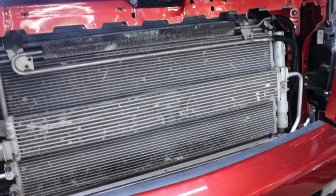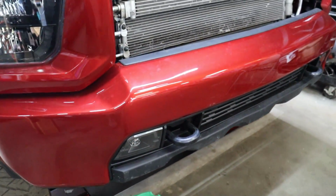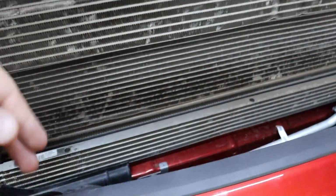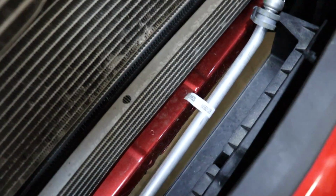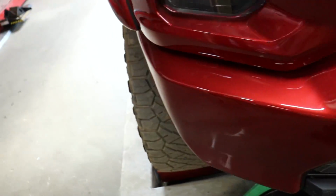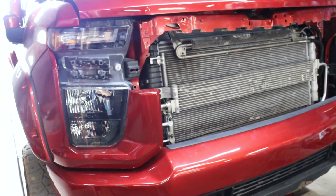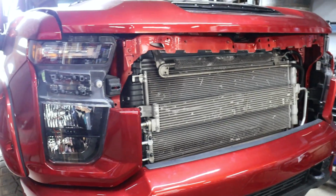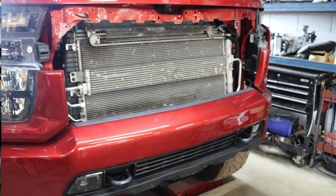Lots of pieces, let's go ahead and tear it down again, get the old one out, and get the new one in. We went ahead and took off the front grille so I don't damage anything. I'm going to go ahead and take off this front bumper because I feel like I might scratch it, and I really don't want to, and I have to get down in there for that little shutter. So right there, if you could see it, it's hard to see. There it is. So it's basically get inside of there. It's only a couple bolts holding that front bumper on. I might as well just take it off again, put it aside, get all my pieces in there. Easier to get to the radiator, that way I don't mess anything up. Yep, so let's go ahead and get that front bumper off and keep digging.